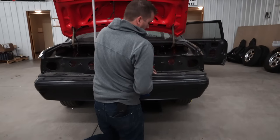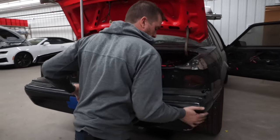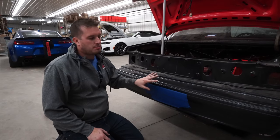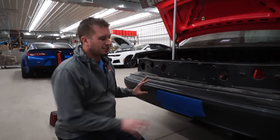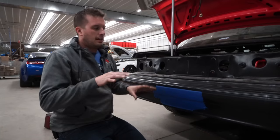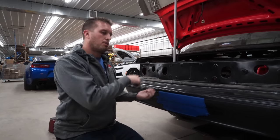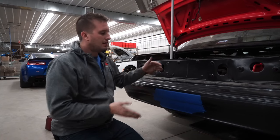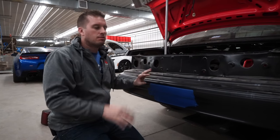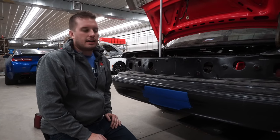It's typically a two-man or woman job, but this is not a nice car so we're not overly concerned. Our bumper cover's back on — a lot of people's tendency is to just leave it loose, but I suggest putting a couple of bolts in at least in the middle. Otherwise you might have some sagging, so when you drill the hole and bolt it back up it'll be way off. Just remember: when you move something from this distance to this distance, it can change quite a bit. Just throw a couple of bolts in there semi-tight and we'll move on.